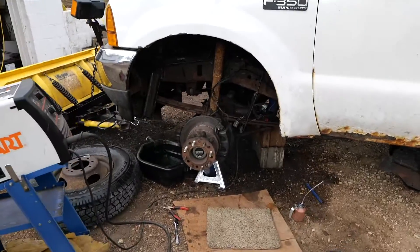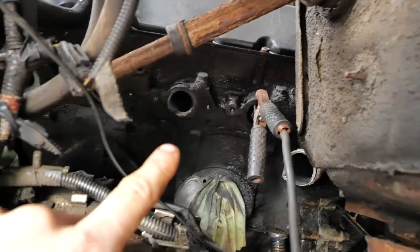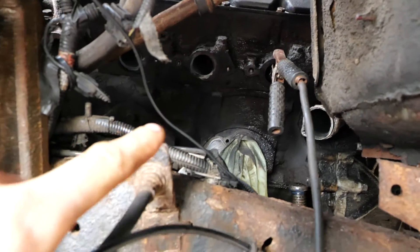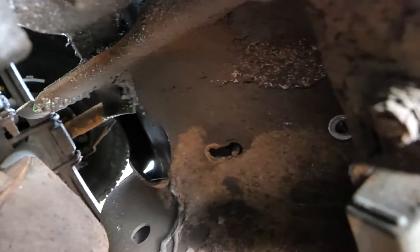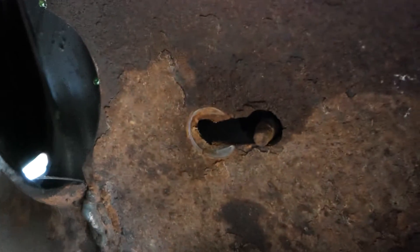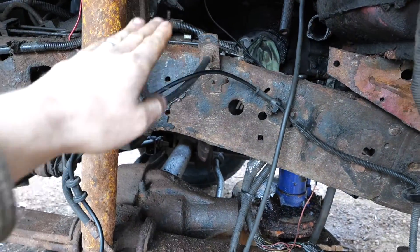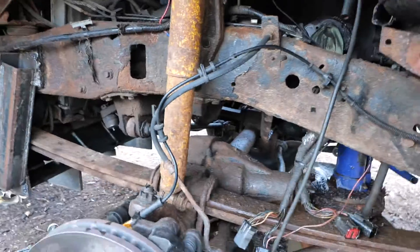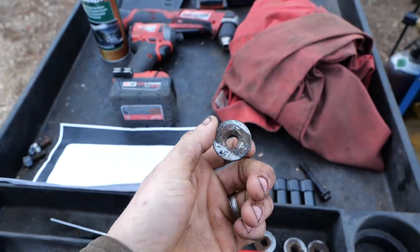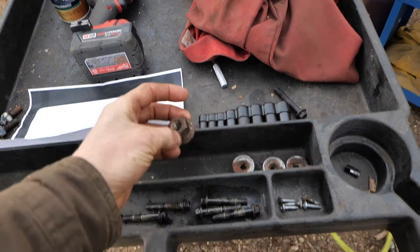I took the wheel off and access to these bolts right here was poor because of the angle — they were a lot lower. So I disconnected the engine mounts. Basically, that hole right there is the location of one of two, and there's one above it. Directly behind this crossmember that goes under the oil pan is where the engine bolts on to. All you've got to do is get out these big nuts — they're easy to get out, at least on mine. They must be made of better quality hardware.